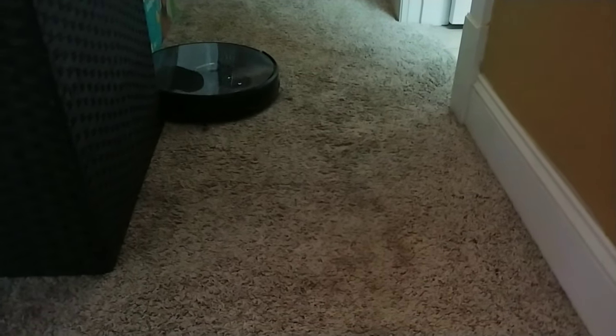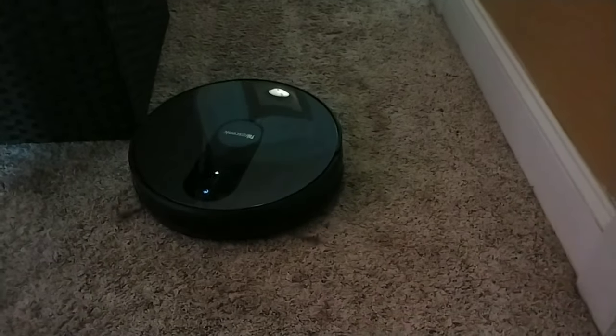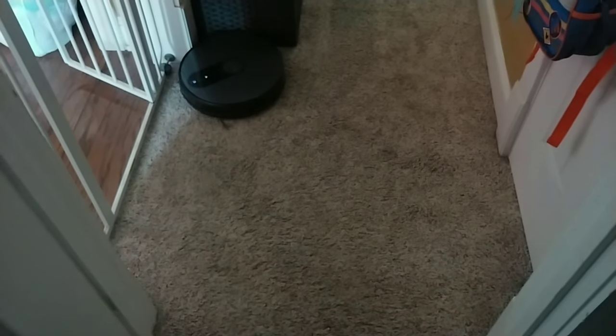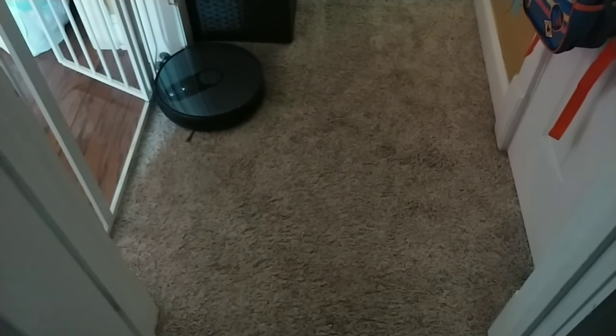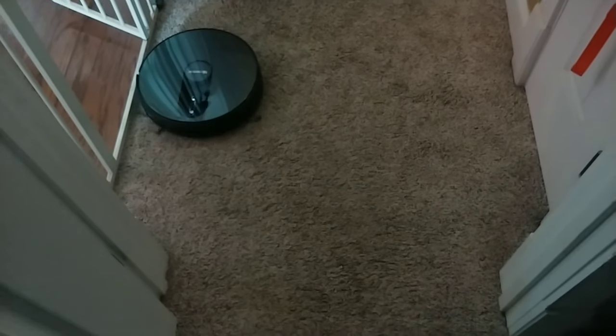Look at those wheels - they are super springy. They push back, but yet they allow it to sit down and suction the floor. Over carpet it can do it - it can nail medium-pile carpet. I wouldn't go past that, but it can do it. It's edging right now - I just put it on edging to show its carpet capability. You can see some obstacles out there; look how it's keeping itself maybe a half inch or so from the wall and letting the brushes in front of it, that stick out past the robot, do the work and kick things toward it.